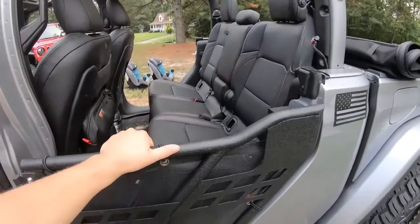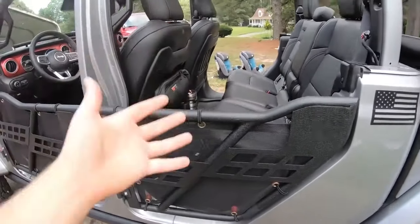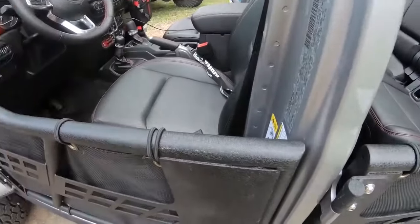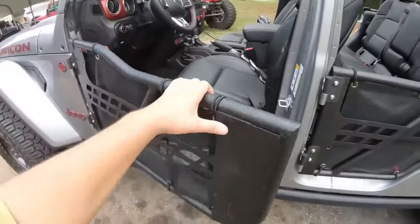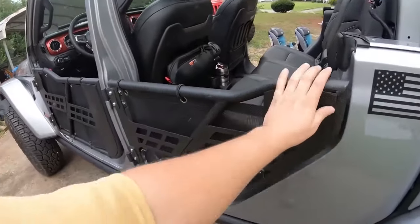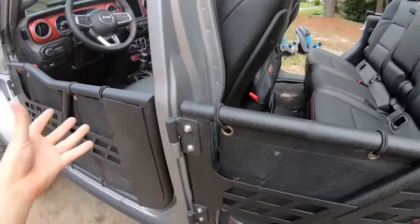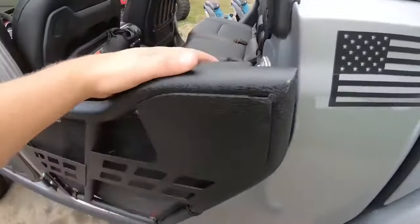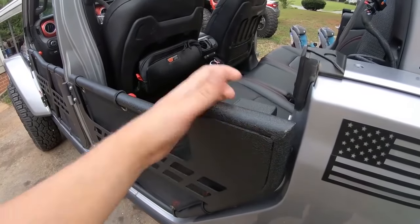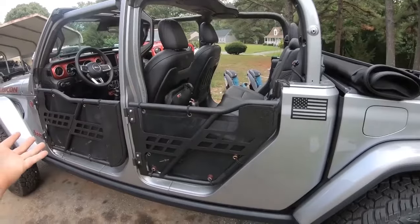For now in car seats, because they're sitting up so high, I think these are going to be nice — and they definitely look really cool. It's a very familiar style. In the future I might upgrade, but for now these work perfectly and they're not too expensive: all four for $315. The latches right on the inside work really well; I was actually really impressed. There are adjustments in case it doesn't fit perfectly out of the box — just loosen these two bolts right here on the hinge, close up the door, make sure everything settles, and tighten it all up so there's no wiggles. These actually fit really nice. Let's go throw the other two on.